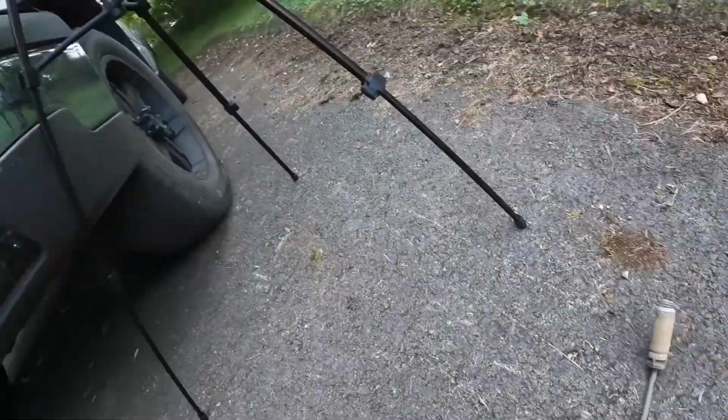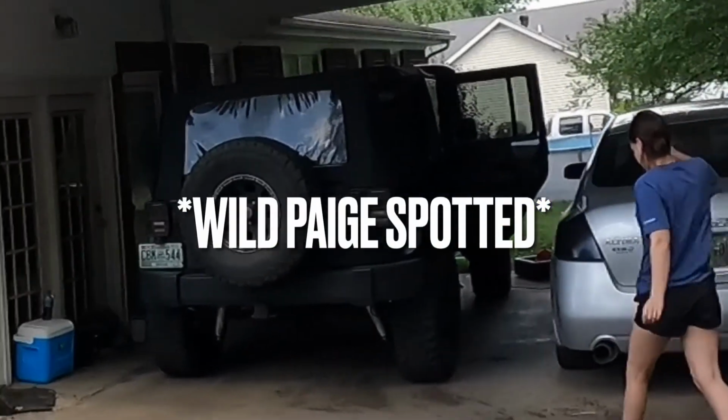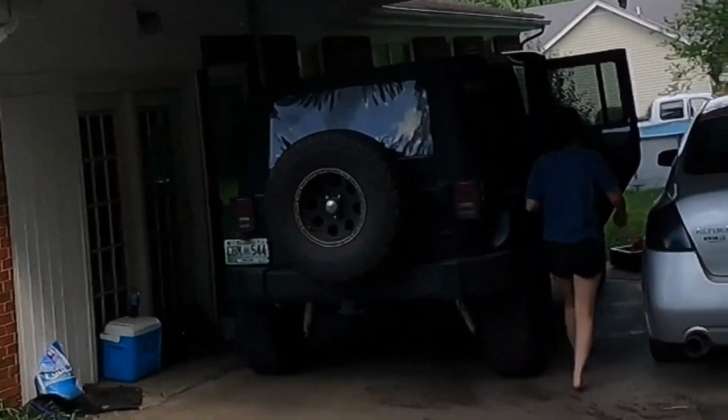So, I don't know. I'm almost thinking they were factory. I don't know, the truck still ran. I don't know how. It ran fairly decent. So I'm going to go ahead and throw those new plugs and wires in here, gap them all. I don't think they're gapped yet, but I'll get that and fire it up and show you